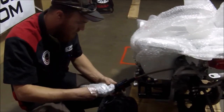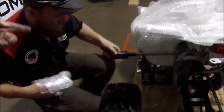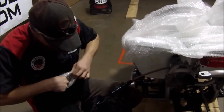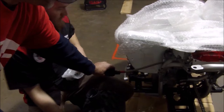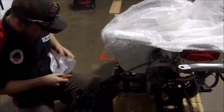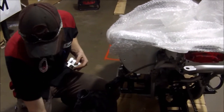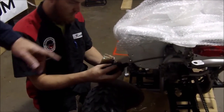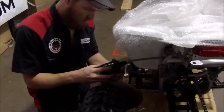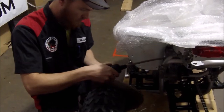Keith has the shock reservoir. You can adjust the rebound in that shock reservoir — it has a dial gauge. It's really sensitive and it works extremely well. These are one of the best shocks you can get on a mini ATV without spending thousands of dollars for aftermarket shocks. They're filled with nitrogen. It comes with the mount — the chrome mount has a rubber sleeve to protect it so it still looks all nice and pretty.